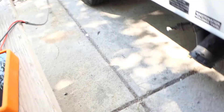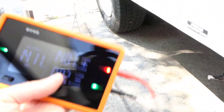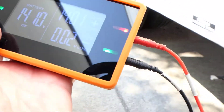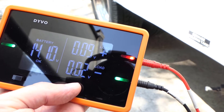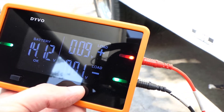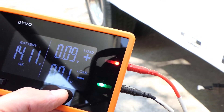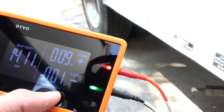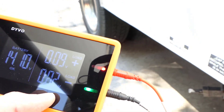Let's check the ground to the house battery. I'm going to connect that clamp. Let's look at the ground. The ground we can see is good — 0.02 volts on my ground side and we get a green LED. But the positive side, we get that red LED and we have 0.09 volts. We definitely have no connection between the engine battery or the starting battery and the house battery.